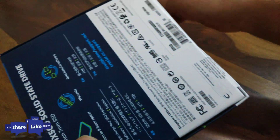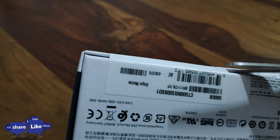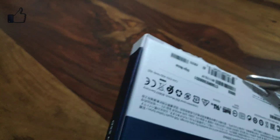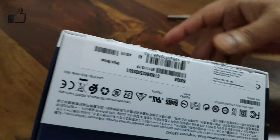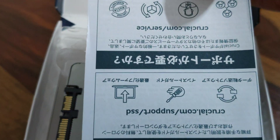The laptop is a Dell Inspiron N5110 — it's a little bit old. The reason I went for this particular SSD is because it has SATA 3 support, the 6GB SATA. I didn't go for an NVMe or M.2 SSD because it's a little more expensive, and second, it's not required — it won't support the newer interface anyway, so it won't improve performance.